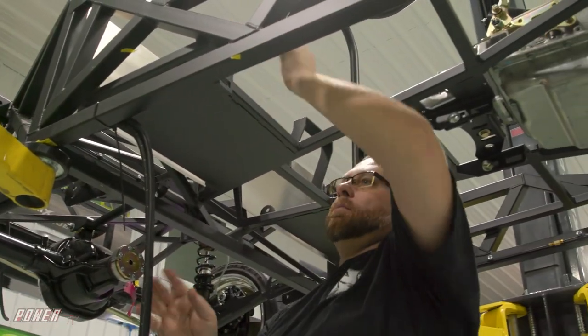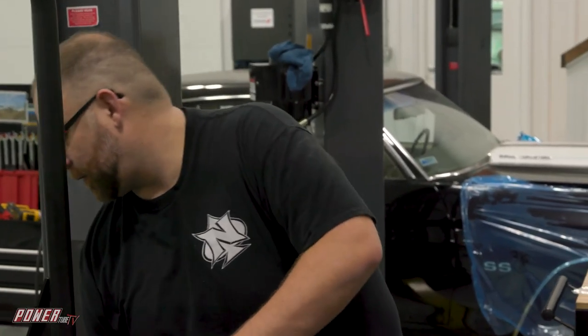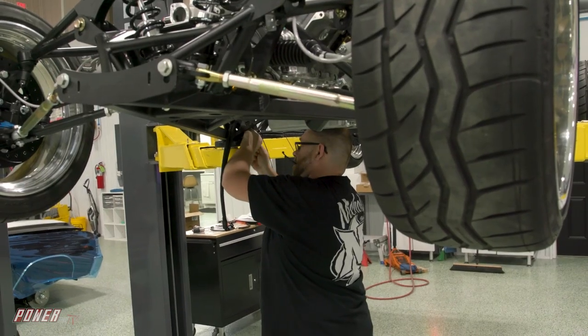When you're too close to the exhaust, anything moving is usually a bad thing to have next to it. If they're hanging too low on the bottom side, you don't want to put them down on the bottom where if you bottom out on a speed bump or something — this thing's going to be like 4.5 inches off the ground — you don't want to catch them on anything and tear them, smash them, pinch them.